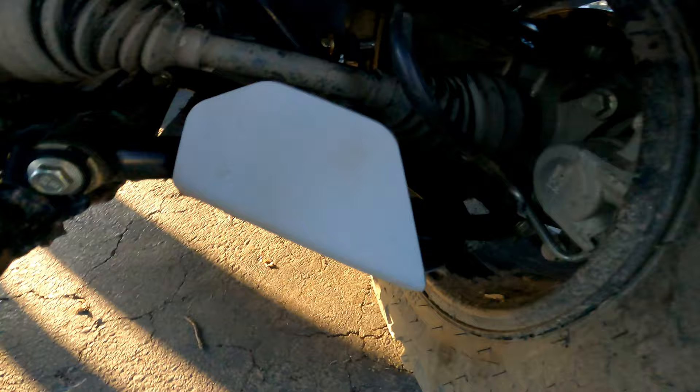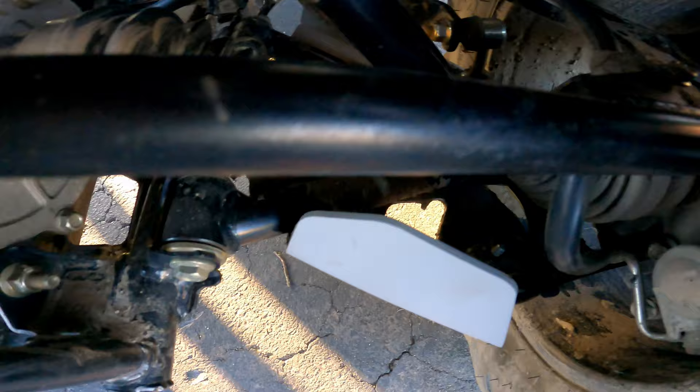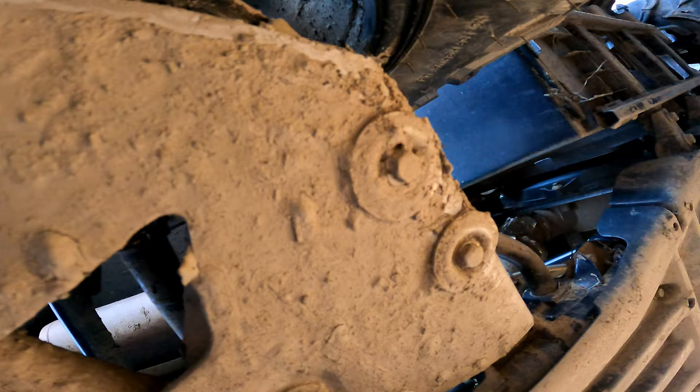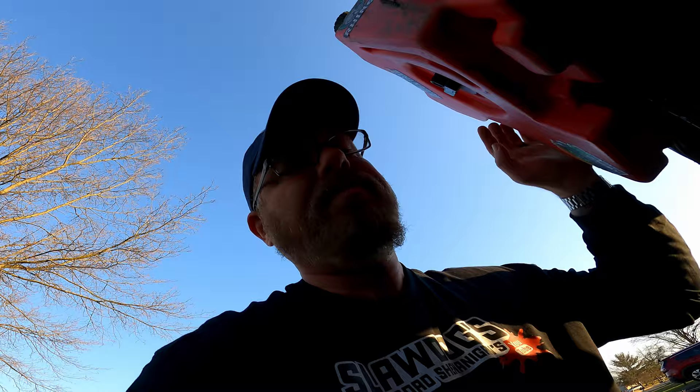The rears — and as I said I broke one of the nuts — I literally had to hold this bracket right here with the top of my foot holding it up into position while I put this hanger on and screwed it down. Then over here is another hanger that I had to get started. The bolt on the left side is the one I broke. Just make sure you clean that out really well with an awl or something thin and sharp — get all the dirt out. Otherwise you'll drive that bolt up through the threads, compact all that dirt, it'll bottom out, and you'll break it. Hopefully that helps, guys.